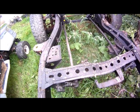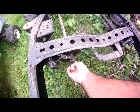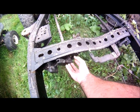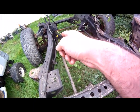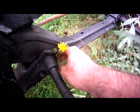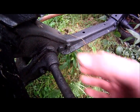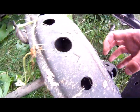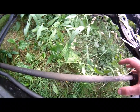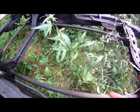You don't want to do this while the torsion bars are under any pressure from the vehicle weight. Basically, if you look at the back end of these torsion bars, there's an anchor. The torsion bar feeds into this anchor, and this anchor can pivot. It has splines in it, so it slides onto the end of the torsion bar. The torsion bar slides into the control arm. There's an anchor mount on the control arm here. The torsion bar feeds into this — it also has teeth on it. This is spring steel, so if you twist it, it's going to want to spring back to its original shape.